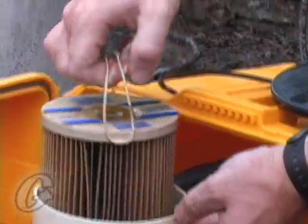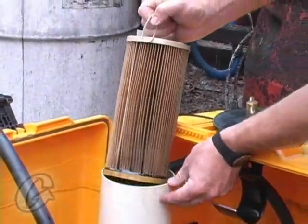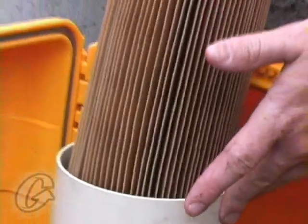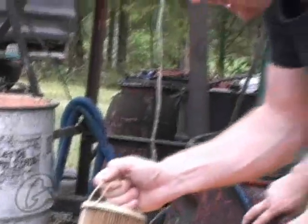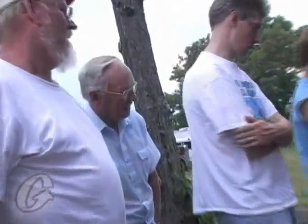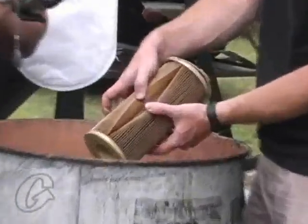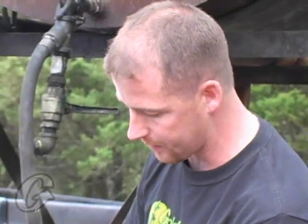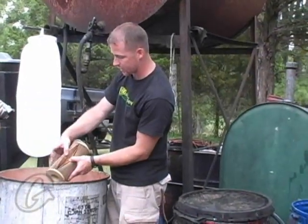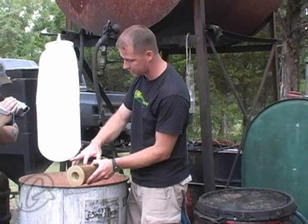I've got the gasket here — that's important. This filter element really isn't that dirty. If you look close, you can see the little silt flowing out of the seams. It looks pretty good, actually not that bad — I probably don't need to change it, but we'll save it. Now come here and take a look at the pleats — you can see where the debris and dirt were starting to gather. If I run my fingernail up there, you can see the fine silt and debris that will clog up the filter.